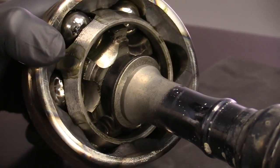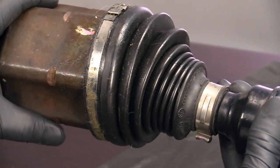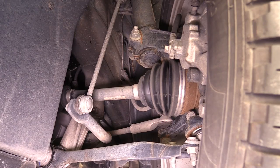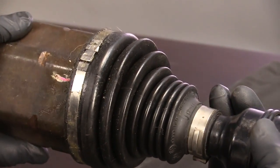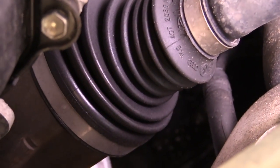So the axles are responsible for doing a lot on your vehicle. There are three main parts to the axle: there's the outer CV, or constant velocity joint; there's the axle shaft itself; and then there's an inner CV, or constant velocity joint. These joints are packed with grease and covered with a boot of varying composition. That boot is meant to not only keep the grease in, but to keep debris and water out. Here we can see an axle attached to a wheel hub. As I rotate the wheel hub, you can see the joint flexing back and forth. Not only does it have to turn left and right, it also has to rotate forward and backwards. While the outer joint needs to be able to flex and turn with the turn of the wheel, the inner joint only needs to rotate and compensate for changes in ride height, as maybe we go over a bump or lean our car hard into a turn. Outer CV joints are typically a ball-bearing style joint, while the inner joint is a little less complicated in its construction.